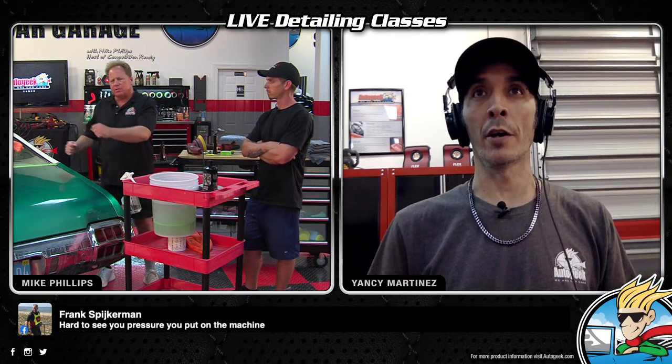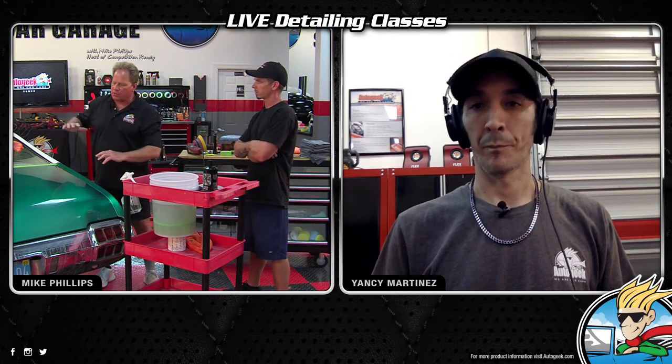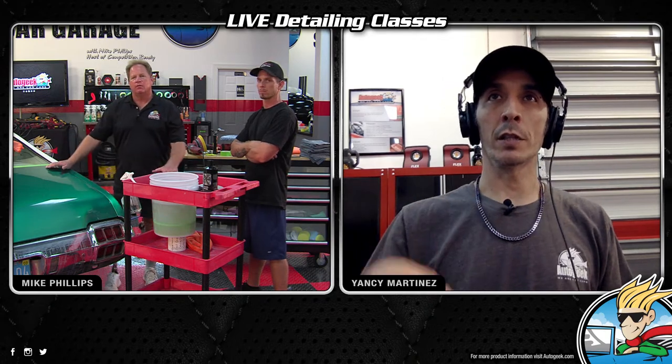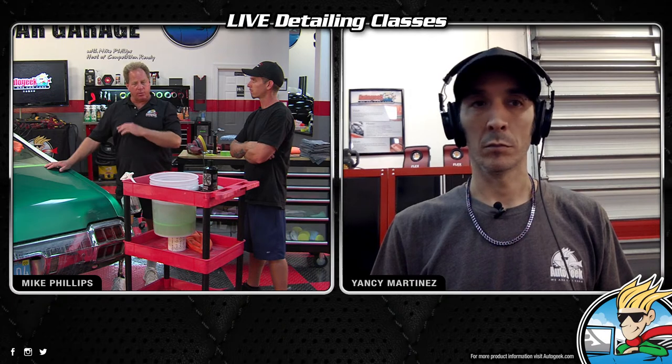A little bit when you're going up on an edge, moderate. Like that, you're pushing on, trying to shove them fibers and abrasives in and cut. You're cutting that paint, you're mowing it down. Then the final polishing, the weight of the tool plus maybe 5 pounds engages the abrasives of the paint, pulls out the holograms.